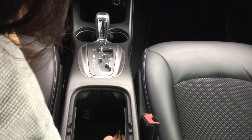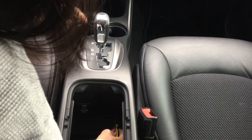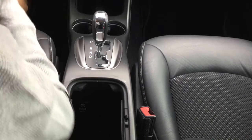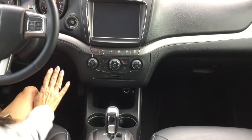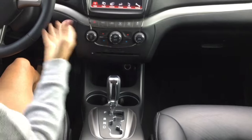I'm going to gently push on that button, put my foot on the brake, make sure my parking brake is on, and then move it into neutral. That allows me to move the shifter — without the button pressed it's completely locked. I go ahead and let go, then start the car back up and it starts right up. I can feel my brake properly now — before it was hard, now it's back to normal.